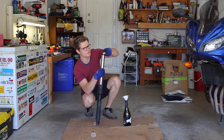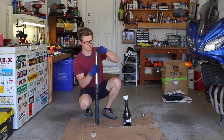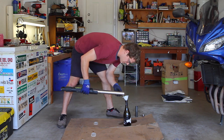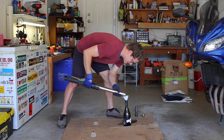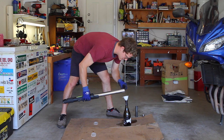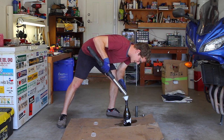The top cap has an O-ring on it to seal it in, and it might pop up just a little when you open it because there's a spring inside. The oil is coming out actually really clear — it went in a bluish green and it's still bluish green. There's a bunch of particulate in there though. Keep a finger on the spring so it doesn't fall out. To get all the oil out you have to compress the fork and extend it repeatedly.